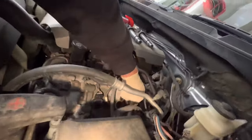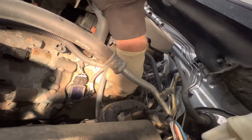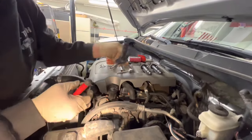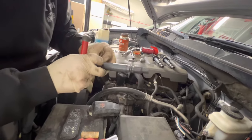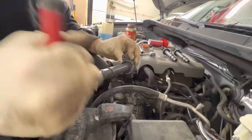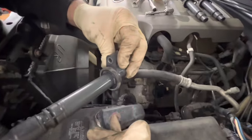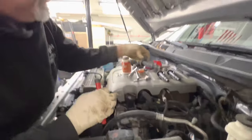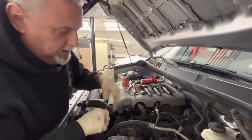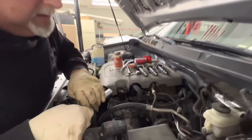This just came off and sits on the cylinder head with a little rubber under the boot. The other ones stayed right on — it just locks into the boot, it's got the little clip right there. A couple came off but these first two didn't. This stays on with the boot. These are all silicone sprayed and dielectric greased, so all I have to do now is tighten this up.